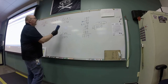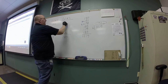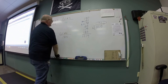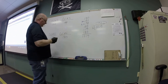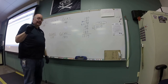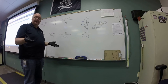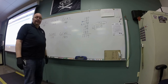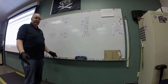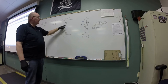Now if we had something different — say this low cylinder hypothetically had 99 psi — that would be just barely below the mark, because the service information says we need at least 100 psi and this one would have 99. We would tell our customer: you've got one cylinder that's just barely below specification. It may be okay, but one of the things we need to do to find where the problem is is a wet compression test. I'm going to show you how to do that now.